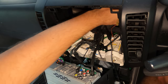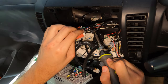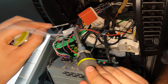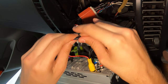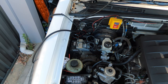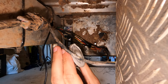First, I'm feeding the wiring through to the back of the head unit. Next up, I'm tapping the earth of the reverse camera wiring into the earth of the head unit. After plugging the camera into the camera input, I'm splicing the positive feed from the camera wiring into the reverse light signal wire of my head unit so it knows when to display the camera feed. After pulling the wiring through the firewall and adding some conduit for protection, I need to find a safe path for the wiring to follow to get to the back of the car. At the tail end, I'm tapping the brand new power wire that I ran alongside the camera feed into the existing positive feed of my reversing lights.